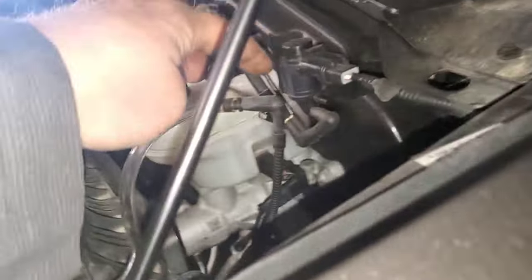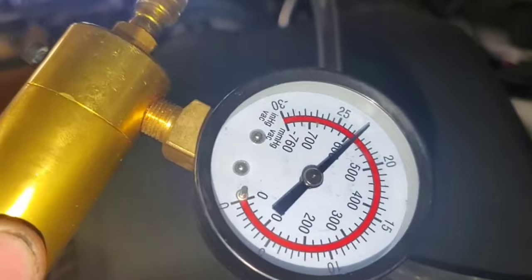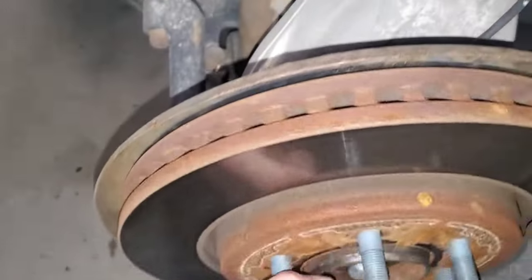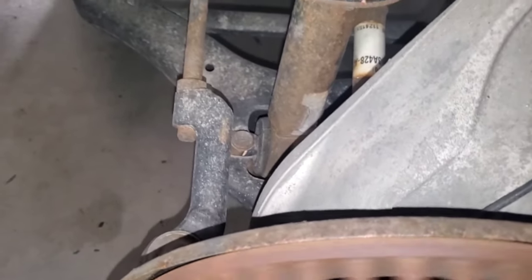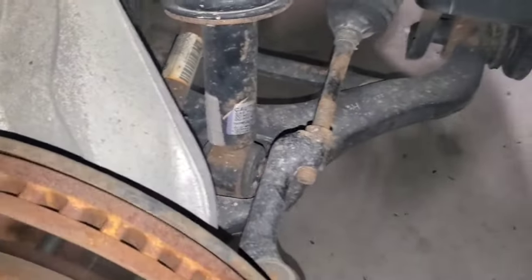Now I'm going to go up to the firewall and pull the top port off of the solenoid and hook my vacuum tube up to that, because it supplies vacuum to both ports, then go down and spin it. You can see the wheel is free spinning with no CV axle engagement, which means my vacuum tubes from the solenoid down to the IWE are also good. I've proved out my lines from the solenoid down — free spinning, no CV axle engagement.